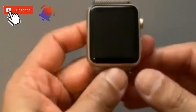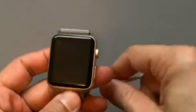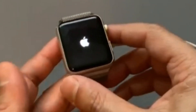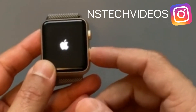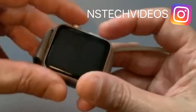If you're new to the channel, hit that subscribe button and press the bell icon so you get a notification each time we upload a video. So let's get started. If your watch is stuck at this screen just showing the Apple logo and not doing anything, keep it plugged in. You'll be holding the power button and the crown on top both at the same time, pressing and holding for about 20 seconds.